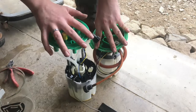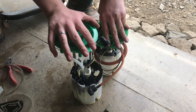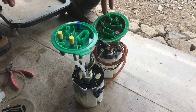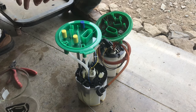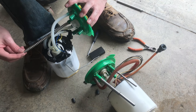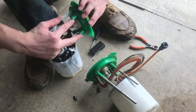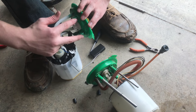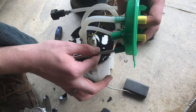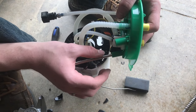This one is definitely higher than the other, and it's also at an angle while this one isn't. As we go along, I keep noticing differences between these when they should have been the same. I'm going to switch out the pins between the two, because the pins coming out of the new pump are in straight holes, but these are obviously at an angle. This pump has the places to accept angled pins, but the pins are in the wrong holes — that's why it appears too long. I'll work the pins out with pliers. This metal shaft is much too big to fit in that hole; I'll probably need to take off about 5 to 10 thousandths for it to press fit in there.